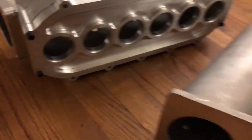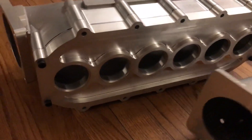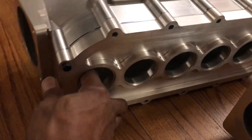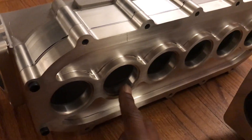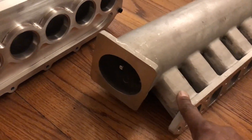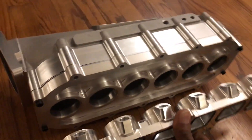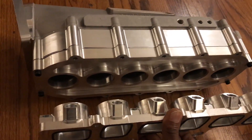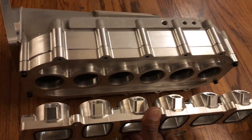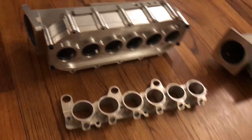As this piece is bolted together you can already see the difference — that versus this looks beautiful. A few more things to get done: I need to pick up the pipes to be welded in as our runners, which will simulate the factory runners, then weld our adapter plates in the back. It'll be pieced together similar to this and will look pretty nice, with provision for our extra six injectors alongside the original factory direct injectors.